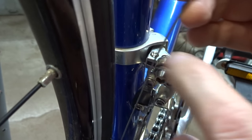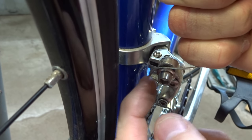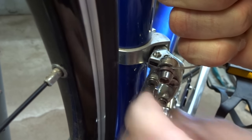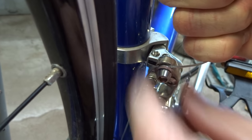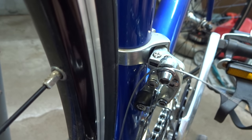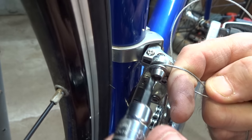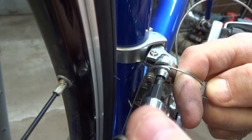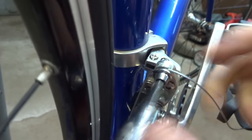This part can be a little tricky as far as how the cable goes through this little clamp screw. On this particular one it goes over the little nub in the back there, and then there's a little slot in there — if you look underneath the screw there's a little slot that the cable fits through. If you have any doubts, go online, search for the particular derailleur, and look at the instructions to see how they show the cable going through. So I'm gonna pull this cable taut and then tighten down this little clamp screw to clamp the cable into place.